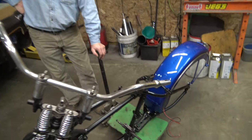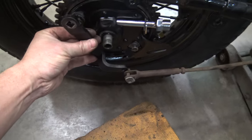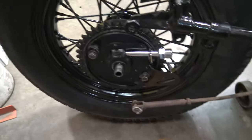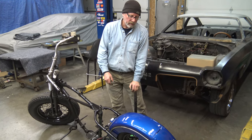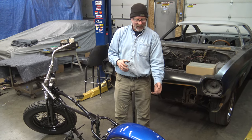We're going to put a little corrosion inhibitor on there — should be a good ground for our tail light. We got the fender on, just keeping it loose right now because it's a spring action; you've got to leave everything loose as you're tightening it up. We're visualizing how this brake goes — I'm pretty sure it's going to go the low road to this arm. This is all bent. We took this off because it was up in here and it clearly doesn't go like that.